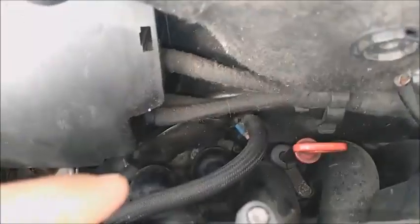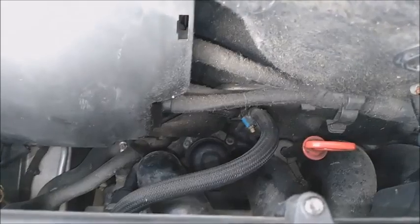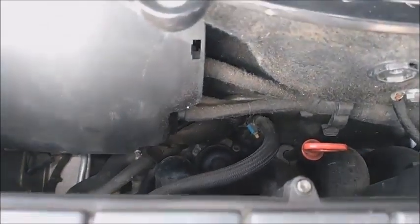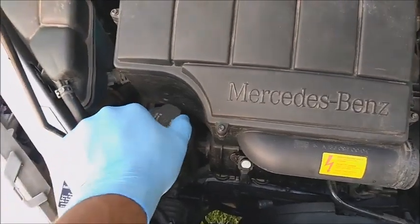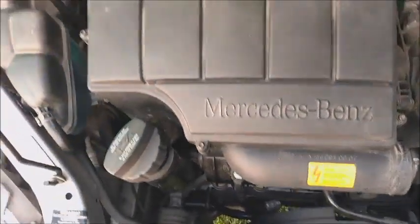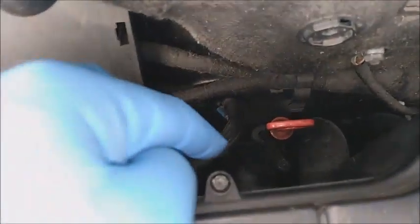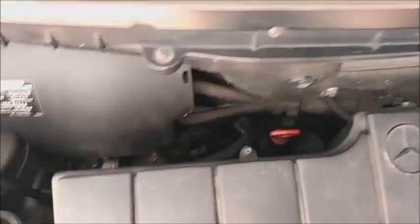It will be obvious. From the engine compartment, there's just the oil filter, which is located very deep down there, so it's a 27mm socket. I'll start by removing the oil cap to release the pressure and allow all the oil to drain, and it's better also to unscrew the oil filter cap, since I'm going to change the oil filter, also the drain.